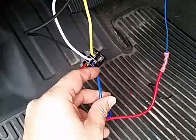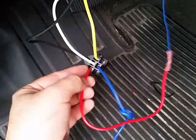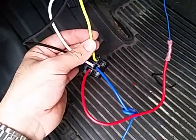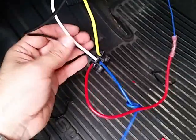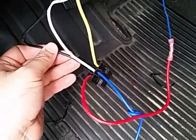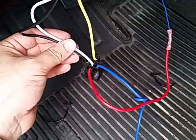Pin 87 is not used. The output wire from the alarm goes to pin 85. Pin 86 is your constant 12-volt power supply, which goes to your battery or a constant 12-volt source. Pin 87A is one side of your hood sensor up front, and pin 30 is the other side. These two act as your wires that cut the cable on your hood sensor.